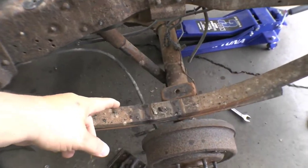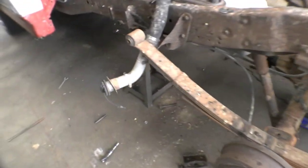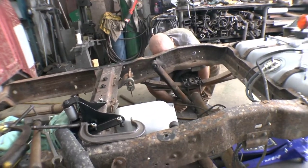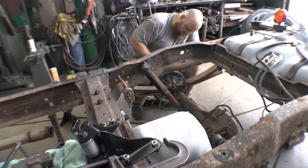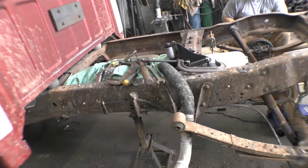On this side I took the U-bolts off. Kagan's taking the shocks off right now. I'm going to take this spring hanger loose and then we've got to change out these bushings — I'm going to try the trick of taking a quarter-inch bit in there. It looks like we're about ready to have one shock off, then it's down to the last one, and then I've got to take that bracket off and we're golden. We'll set the camera up and show you guys how to remove rivets off brackets without causing sparks. See you in a minute.